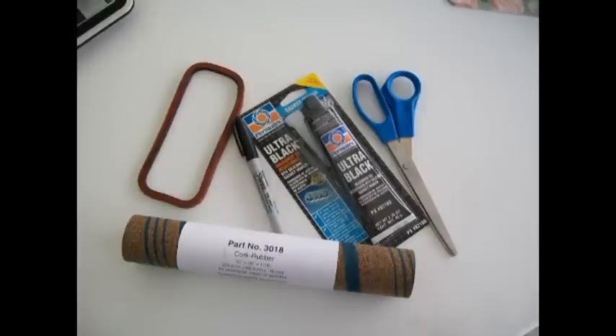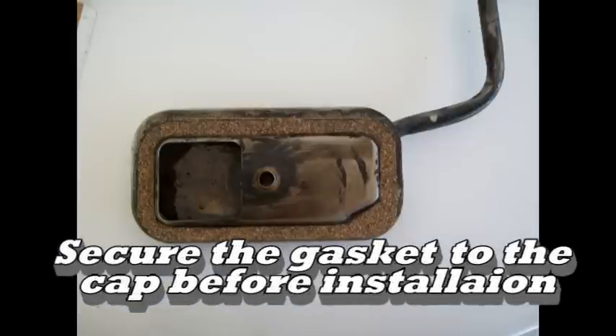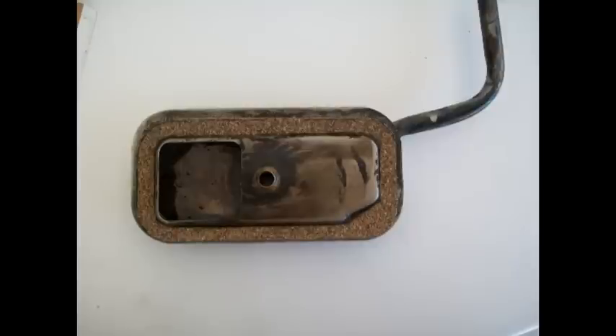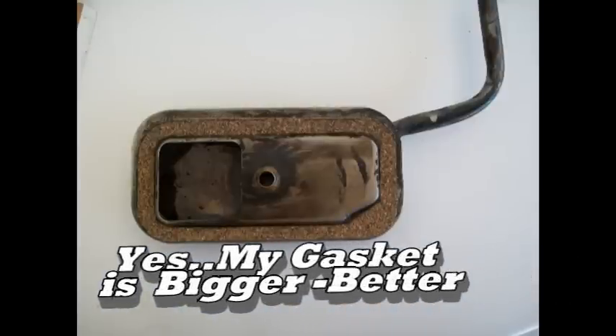I went and ordered a new rubber gasket, and that gasket is not shaped to cover the surface that it's intended to. I got upset over that and made a cork gasket — I have a picture of that I will show — where I traced the outline of the cover and provided much more surface area for the cork to nestle against the block. Then I ordered a couple from Victoria British, and when they came, the cork ones were right, and I could have purchased them and put them on, had I known. But I went by what was on the engine in the first place — the rubber one.